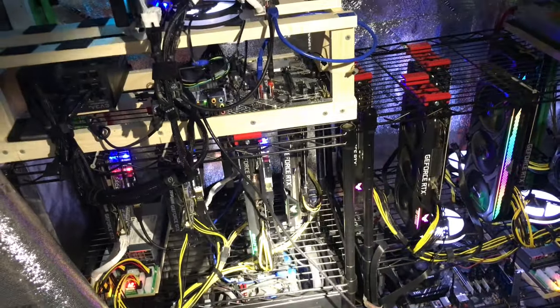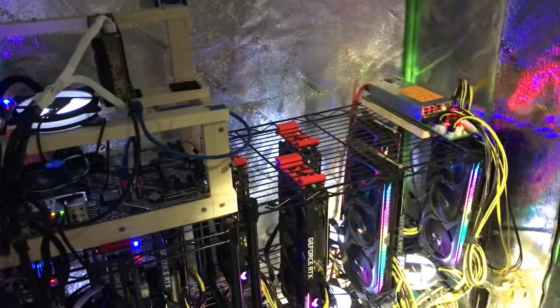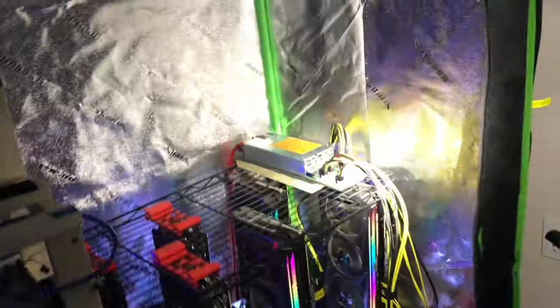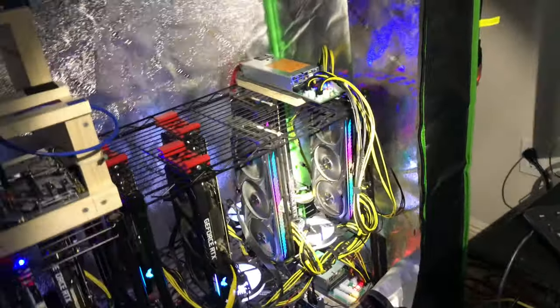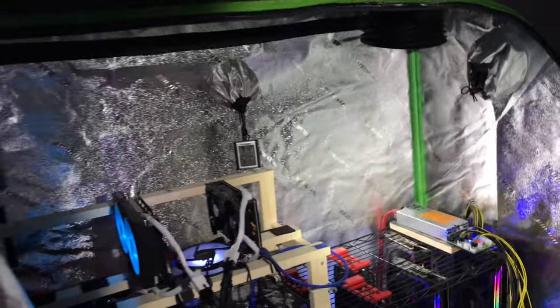Last week I pulled the case out to reconfigure stuff — a couple-hour effort. Once things are working, try not to mess with it. Plan ahead: think about what you want to do. Hot cards should go on the left where cold air is coming in, because that hot air will work its way up and out the 8-inch tube. Air could back up and make the cards burn hotter. I run GPU fans at 100% because fans are cheap and easy to swap.